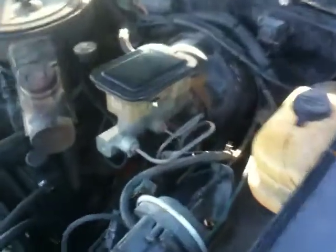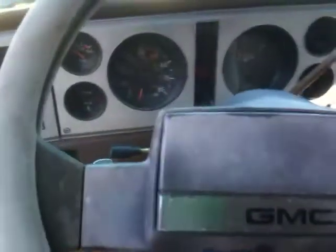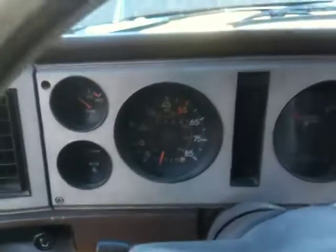It's a good running truck though. That brake line needs to be changed or cleaned up — it has a little bit of a leak right there. Other than that, it's got good power steering, good running truck, temp gauge works, gas gauge works, volts work. The oil pressure works, but I'm thinking the sending unit's going out because it works when it wants to. So it just needs an oil pressure sending unit and a speedo cable, and the water pump.